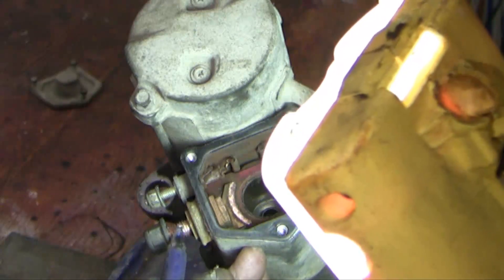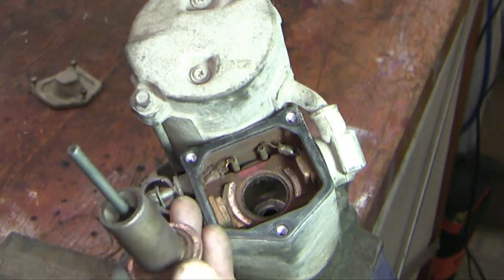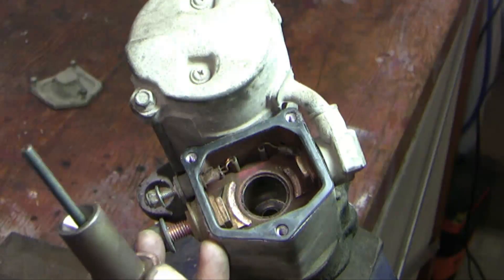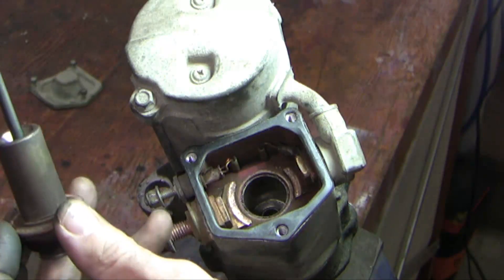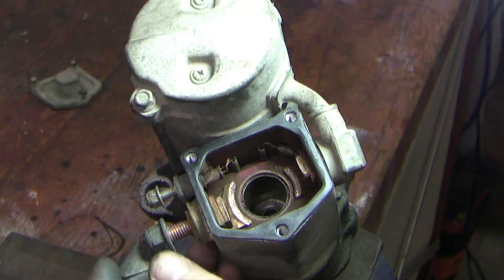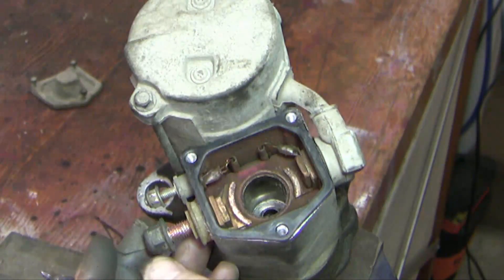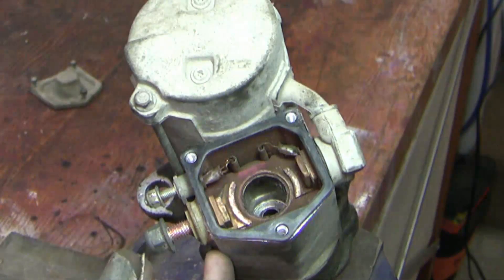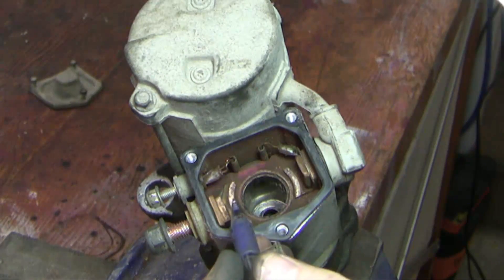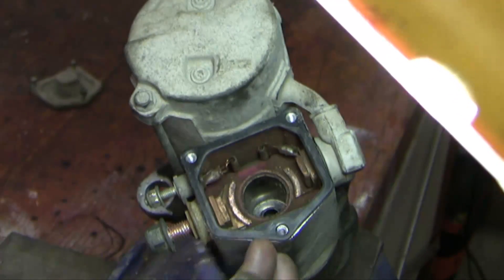When my plunger was pulled downward, contact allows electricity to flow from the B post through the circular disk — which can spin to any position each time so it's not always making the same contact — and then power goes through to the motor windings and off to ground. I subsequently learned that these contacts are easy enough to replace: just undo the bolts and replace the contacts and the plunger for about $30 on these Nippon Denso starters. I could have saved significant money doing that myself, but up here in Canada the shipping and handling is about double the parts cost, so it's only a bit cheaper than buying a rebuilt starter. If I lived in the US and had time to wait for parts, it would be an inexpensive alternative. Thanks for watching.